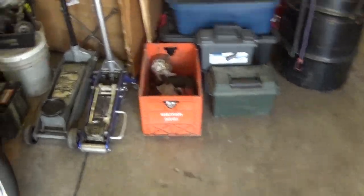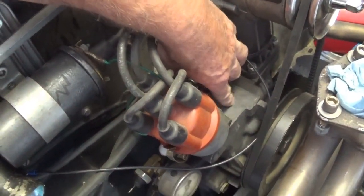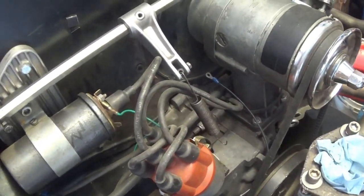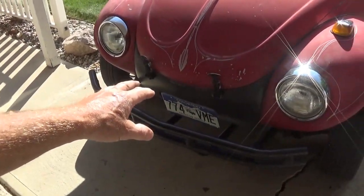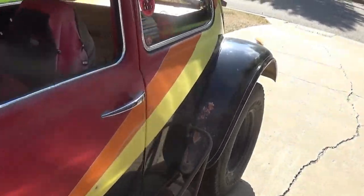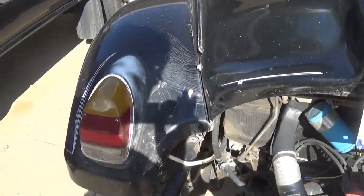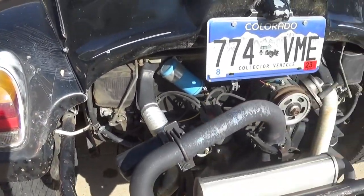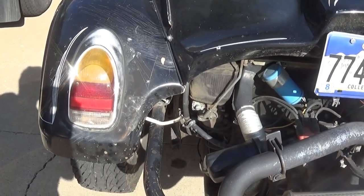On my 1800, it was created from a fuel-injected AS21 case and there's nothing in that space at all — they had a high-pressure electric fuel pump for that fuel injection. The engine came in my Baja, and the Baja had an electric fuel pump running dual Kadrons. They were just a leaky mess back there, tons of dirt and crap everywhere — obvious the carburetors were part of the issue.